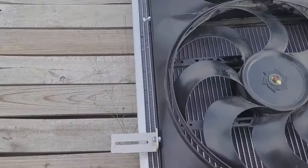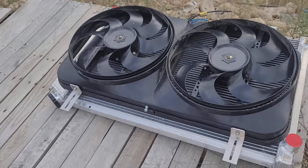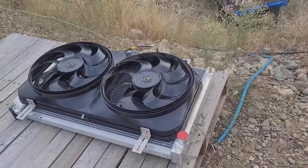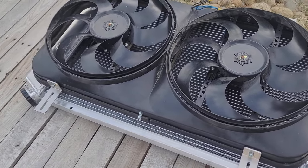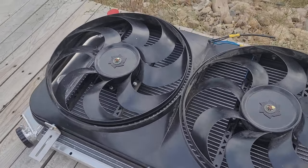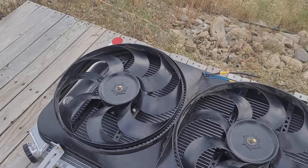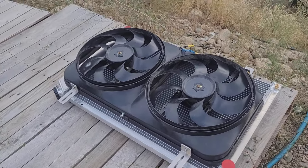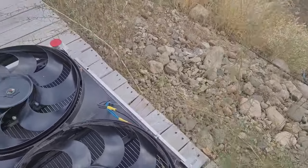At this point I only have two fans. These fan shrouds are a little bit bigger than the radiator cores, so I'm going to mount them right directly to the rad cores rather than in a separate sealed compartment like I had before. It's way less fiddling around than last time — there was so much aluminum work and sealing to seal the cavity between the radiator and the fans. Honestly I don't even know if I got it all sealed. This will be a lot better — the fans are going to be mounted directly to the back of the radiator.